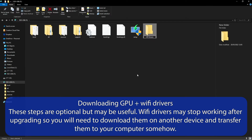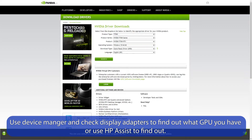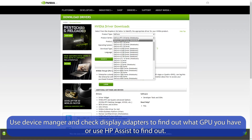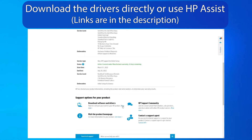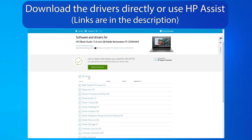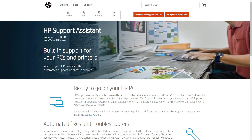You can use other names as long as it does not clash with any folder name that's already there. This folder is intended to hold the optional drivers for you to install later. Skip this step if your laptop does not have a dedicated graphics card. Download the graphics driver into the folder where applicable. For Nvidia graphics cards, go to Nvidia's website and download the graphics driver. Download the wifi drivers as well, as some laptops may not have compatible drivers once Windows is reinstalled and you'll be unable to connect to the internet without them. Download HP Support Assistant into the new folder — this is a tool from HP designed to automatically fetch HP drivers once you've installed Windows.